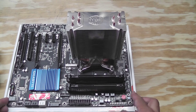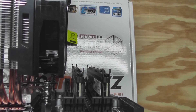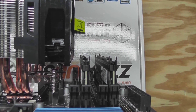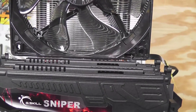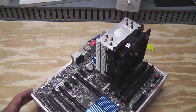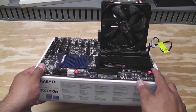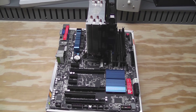Before putting the fan on I went ahead and installed the memory because it's a lot easier to do without the fan in the way. The bottom of the fan is actually lower than the top of the memory, but since I'm only using two sticks that's okay. I did move the fan up just a little bit for proper clearance. That's the CPU cooler and memory installed — the memory is black and matches the motherboard, and the fan has a smoky color that looks really slick. Thanks for watching, see you next time.